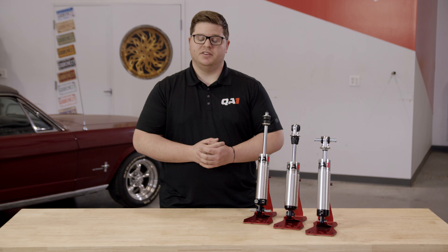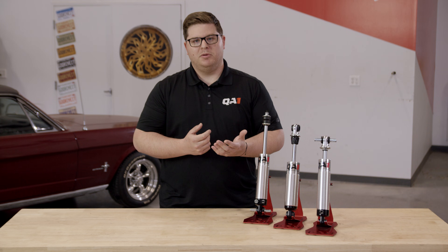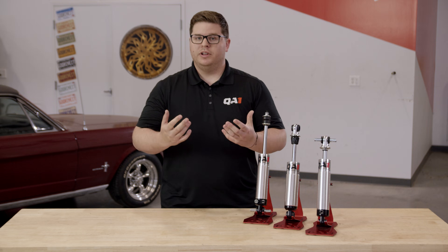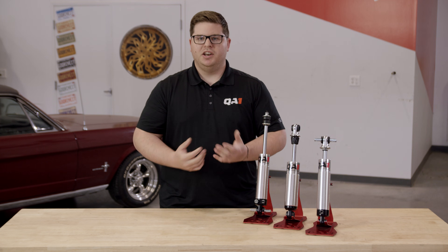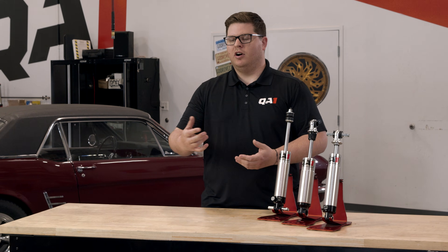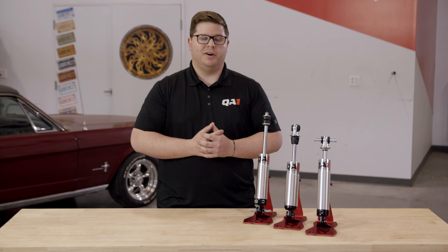The same thing applies to the front end. Now if you've got a factory spring in there, it's going to be pretty tough to do that — you might pick it up off the jack stands. To get the most accurate measurement, it probably makes sense to pull that spring out of there just so you can get that wheel and tire exactly where you need it. A really good way of going about it: if you can build some cradles, or your friend has some, you can just set all four wheels and tires on some blocks and crawl under the car and measure it exactly as it sits — that's going to be the best approach.